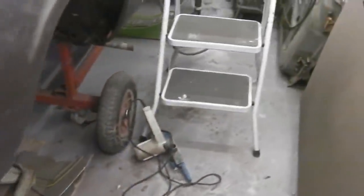We're going to bond the roof channels on with a metal epoxy, two-part epoxy bonding agent, just because it seals and bonds at the same time, and down that roof gutter channel, I'd like that to happen. The ends here will be spot welded on, so I'll have to grind them back to clean metal and put the weld through primer on it nearer the time.